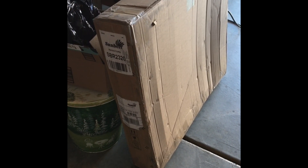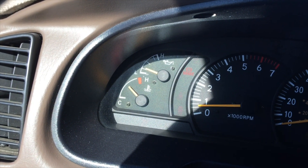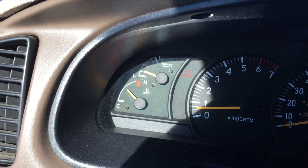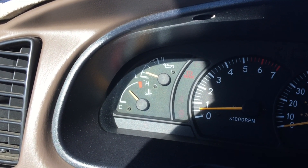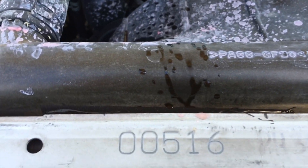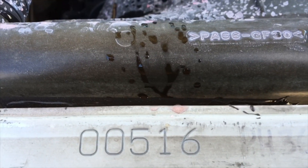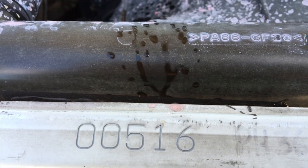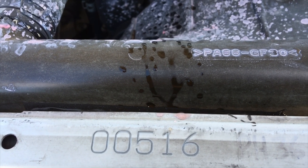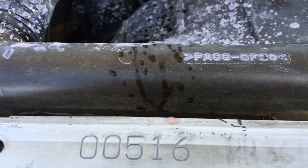My radiator finally came in and I'm going to have my mechanic put it in for me tomorrow. I took this for a small drive and you can see my temperature gauge is in the middle — let's see if we've lost any water in the radiator. This is the front of the radiator and you can see it did lose some, so that crack did not hold. Like my friend said, the plastic from the radiator will expand, the JB Weld doesn't, and it breaks the seal. So I would not suggest doing this.